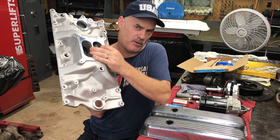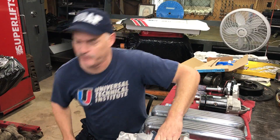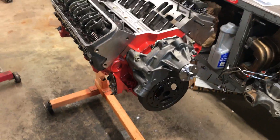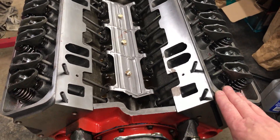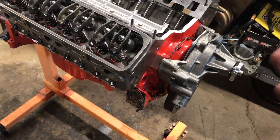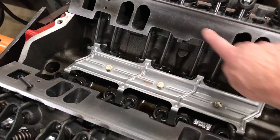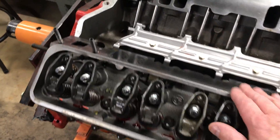What they have available, if you want to put a carbureted intake on a set of Vortec heads — and Vortec heads are a great upgrade. We've got one right here that we're working on. This is a small block that we did, but we upgraded it. These are actually aftermarket Vortecs — these are Dart Iron Eagle Vortec heads. The nice thing about these is they make a lot more power, plus they have an advanced port over the factory. Even the factory heads are great. But with two bolts in front and two bolts in back and no support in the middle, sealing these intakes can be kind of a challenge on these engines.